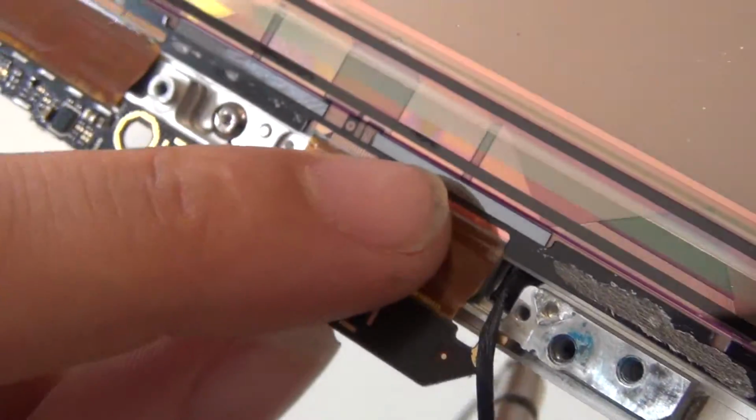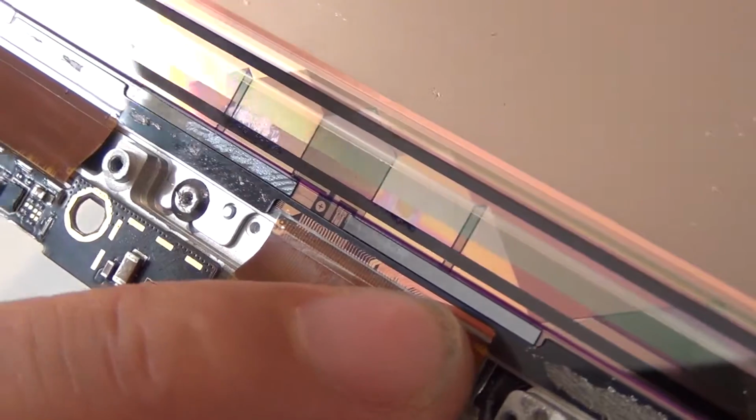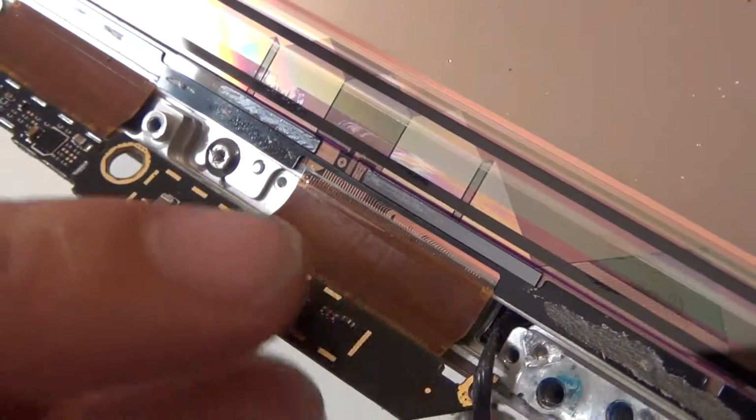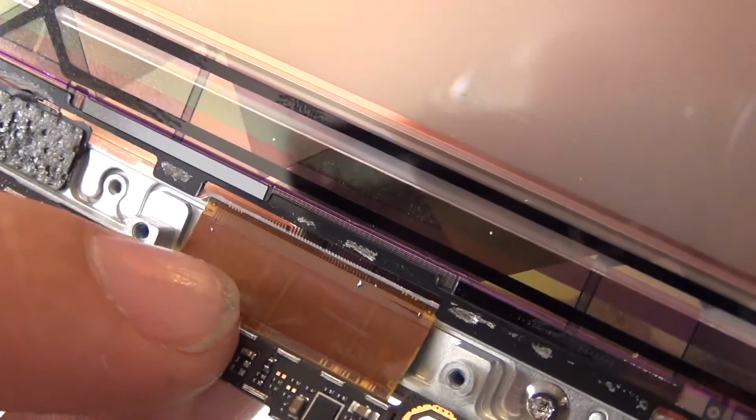And there are the chips on glass. They multiplex the signal to go to all those pixels, because the lines here are not enough for all those pixels. So yeah, just a multiplexer chip. Here's one. Here's one. Here's one. And here's one. And it goes on and on.